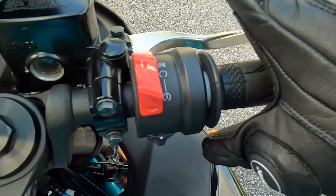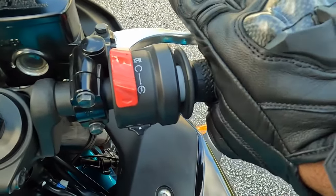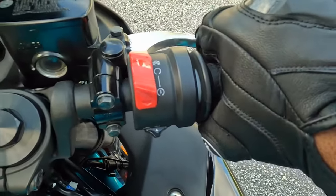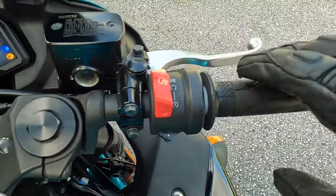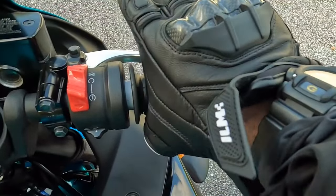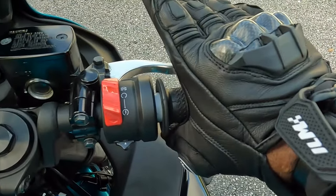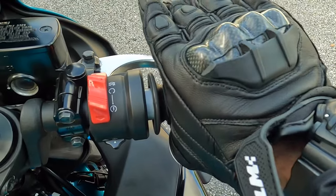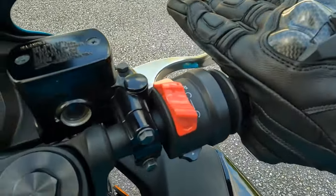Slow movements and slow maneuvers in the city — when you're in traffic this is going to help tremendously. You don't want to give it too much throttle by grabbing a whole fistful and going a little too far, then have to reach for the front brake and start jerking your bike back and forward. So take your thumb, fold it, take the web of your glove — and I recommend thick gloves — your thumb and the web right here is what's going to control the throttle. See how smooth that is.